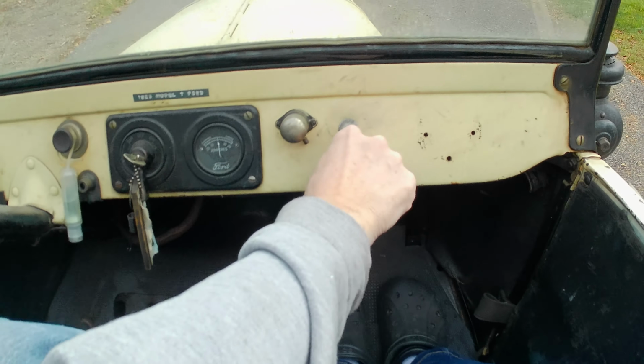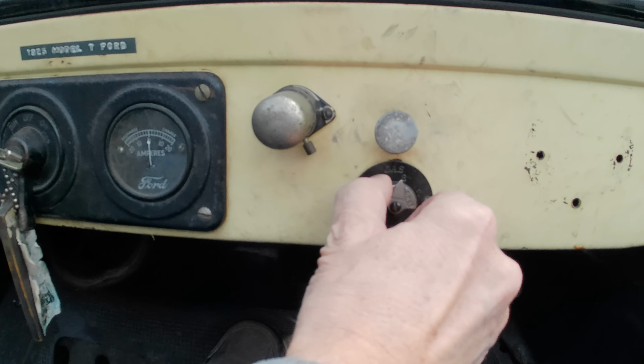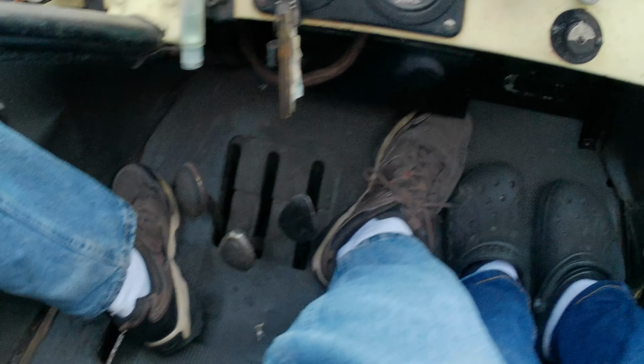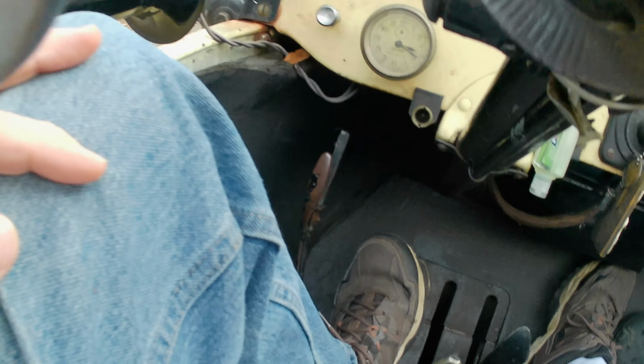So when we get going down the road, still cool. That's an accessory piece. What I'm going to do when we're going down the road is throw this lever forward after I'm going forward. And then I'm going to use the pedal to hold neutral, like that. So now I've got low, but if I let off, I've got high. Without that lever forward. So that lever is more like a brake and neutral. It's neutral here, high gear there, and then brake all the way towards you.